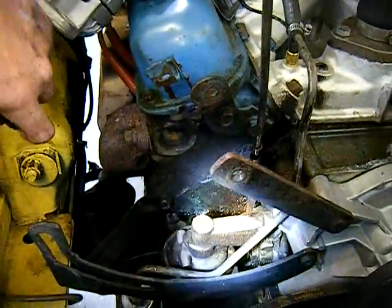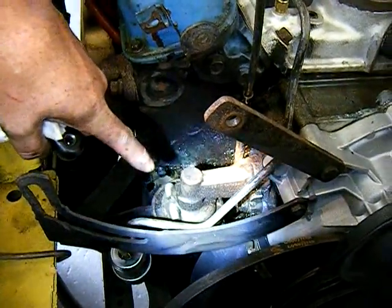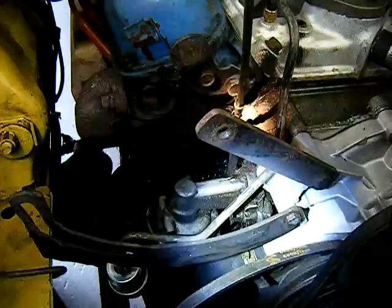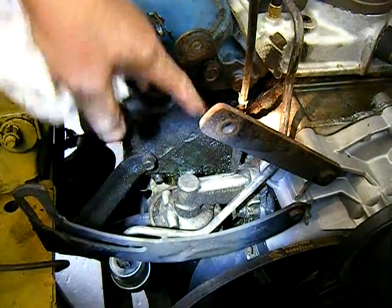What do we got? It's got a lot of oil in this corner. It's dripping off the front of the oil pan, and at first look it looks like the oil pan is leaking, but wind blows it back. The fan wind blows it back and gravity pulls everything down.